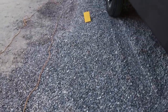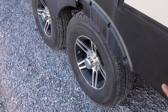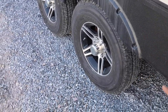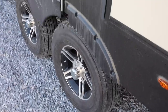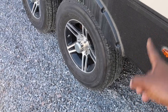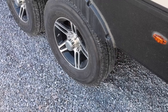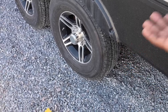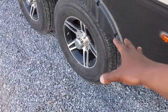Tires are pretty much aired up to 80 psi. One thing I always recommend: do not do this with the sun hitting the tires — it's pointless. Do it while the tires are in the shade, preferably in the morning or late at night. These Goodyear tires — I did take off those Trailer King tires — I have not put air in these probably in about three months, and they are at 79–80 psi respectively. I still set them at 80.1.